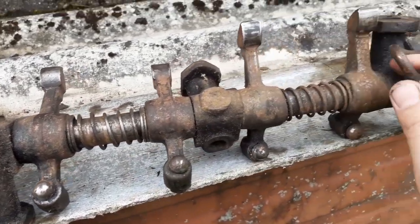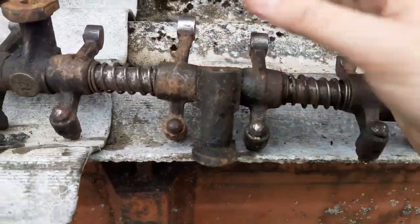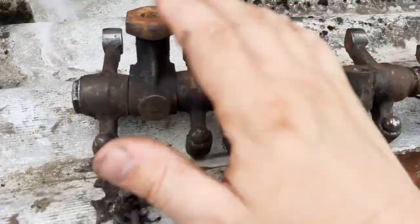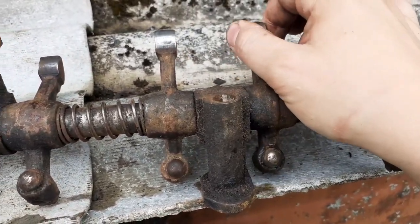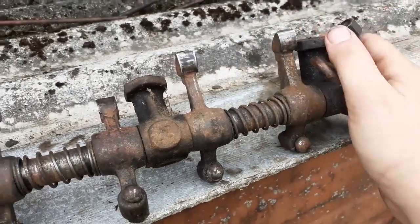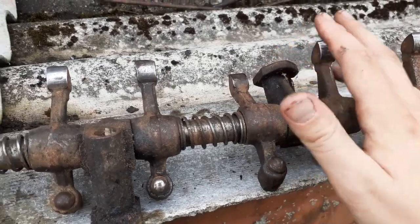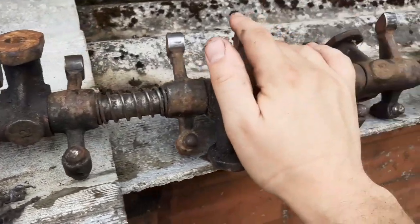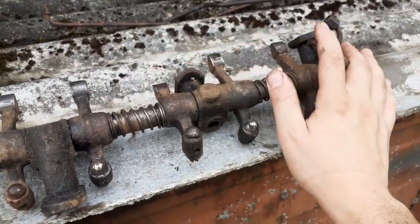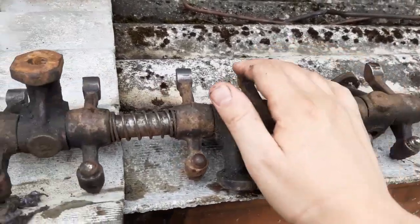You may have to use the older style rockers but can't use the newer associated parts because the oiling systems differ. I'm going to cover them in oil and put them away. If I ever need them, I'll at least have something to work with. These haven't been in production since the late 1970s, so they're not obtainable from a store anymore.